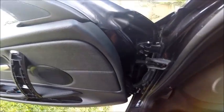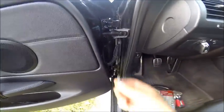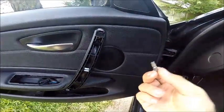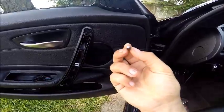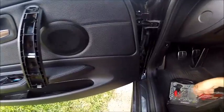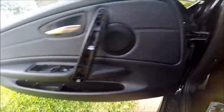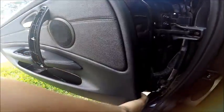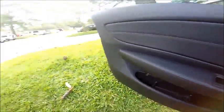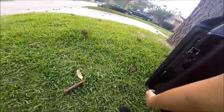The first clip popped — I kind of just put it in up here and started maneuvering it. So in my effort to pull this side of the door away, he fell out. This video was brought to you in part by this asshole right here being dropped in there. From this point I don't need to take the door off anymore, but I'm going to for your guys' sake. You just keep pulling these little pop tab clips all the way off, all the way around. They are very, very secure though — you've got to yank these things for them to actually come off.